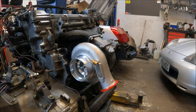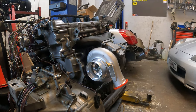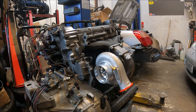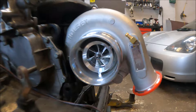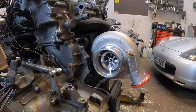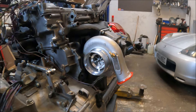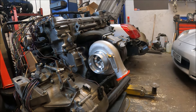They are HX35-size turbine side, HX40-size compressor. This one though — which is why you can't just go by the name on a Holset, you need to know the spec, otherwise you could be buying anything — these are a bit different. It's a HX35-size turbine side, although an 11-blade wheel, so higher flowing than even the normal. But it's pretty much HX35-size compressor too, albeit a billet one — and not even the normal billet HX35 wheels. These are thinner and slightly larger, so it's like 55mm rather than 54mm.